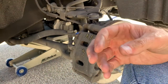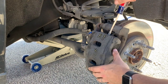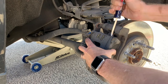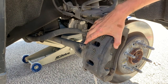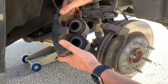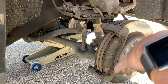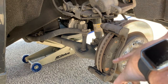Put the bolts somewhere you won't lose them. Just pry the caliper off — don't worry about the clip right there. Always buy your brake pads with the hardware. Once it's off, don't let the caliper hang by the brake hose — whatever you do. Set it up on top where it's nice and snug. Sometimes I'll use a coat hanger run through the spring, but this is nice and steady.